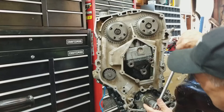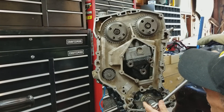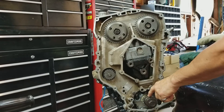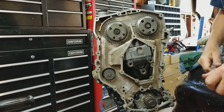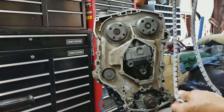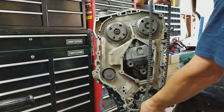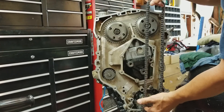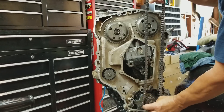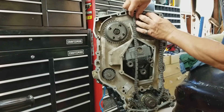Slide that on and tighten it back up. We're going to do this in real time — no cuts — so you can see about how long it should take. I was pretty intimidated by these when I first started; I'm used to working on small block Chevys and I could do those with my eyes closed. But once you get this down it's not too bad. We're going to turn this, lining the keyway up, and that's right on top dead center. Now I'm going to put the timing chain on — making sure the 'Made in USA' stamp is on the outside.